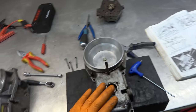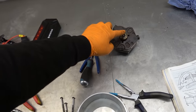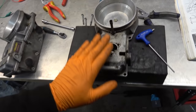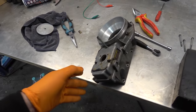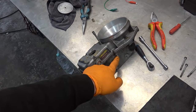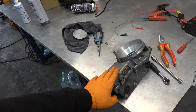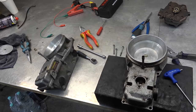I have a used unit from another seller — he said it's in good working order. The piston in the fuel distributor is stuck, but I don't need that section. The baffle plate on this one is flush, so I'm going to use that. It's pretty clear someone was messing around with this car when trying to get it running — there's a non-original BMW bolt — so I need to double-check everything. This is certainly adding to the cold start issue.